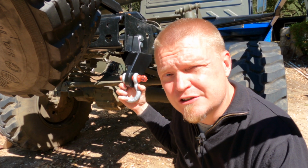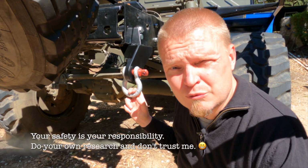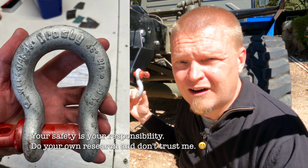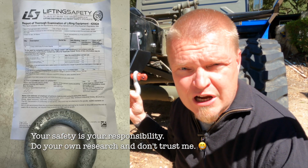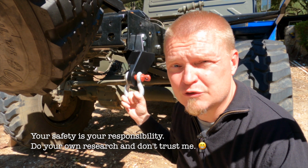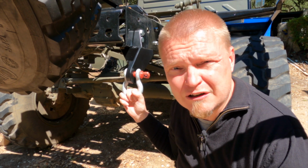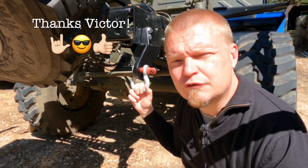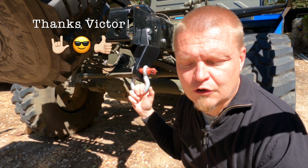And just to make sure that you know everything about everything, these shackles are what's called 3 3/4 ton shackles. They are rated at the lifting capacity as the double, which means that one of these shackles could lift the whole Mog. They also have a safety factor of 6, which means that before they break, we would have to tie together 3 Unimogs and lift from one shackle. Thank you very much to Victor for recommending them. Thank you, really appreciate it. Personally, I have no shackle knowledge.